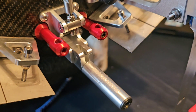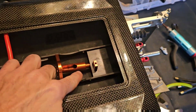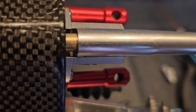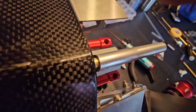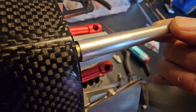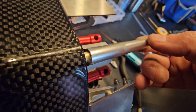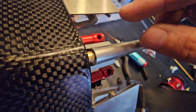I've got the stinger all on and it is good to go. Next thing I've got to do is get the whole rear assembly mounted back together. It looks absolutely perfect. It's got that beautiful little bit of a gap there — it'll go down and it'll go up — and it keeps the driveline inside of the stuffing tube the entire time. And what you see right there is a little bit of silicone.